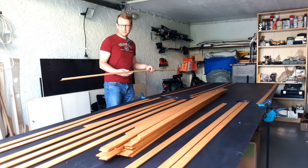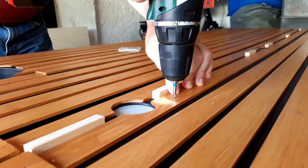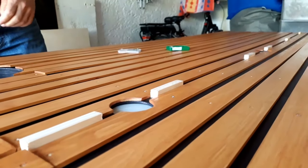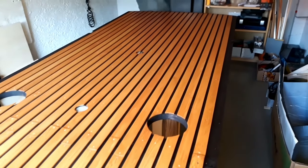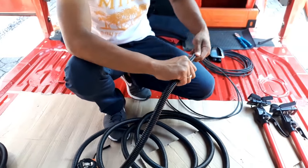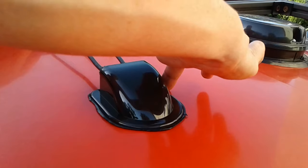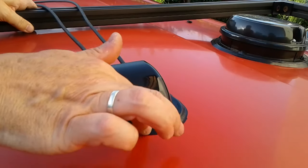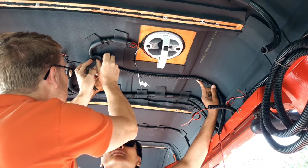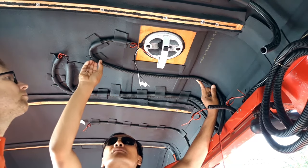Now it's time for a jigsaw puzzle. I am most afraid that the slats might not perfectly align in the front and back sections — that would be the worst nightmare after so much time invested. Before final installation it's crucial not to forget the cables for the LED spots, the Maxxair fan, and the solar panel, plus some extra conduits for cables we might need later. The best way to attach the conduits to the Armaflex insulation is Armaflex tape.